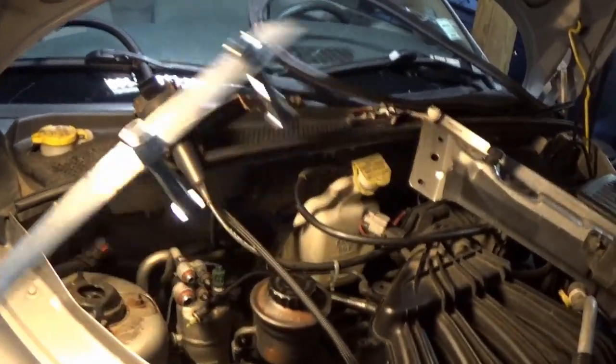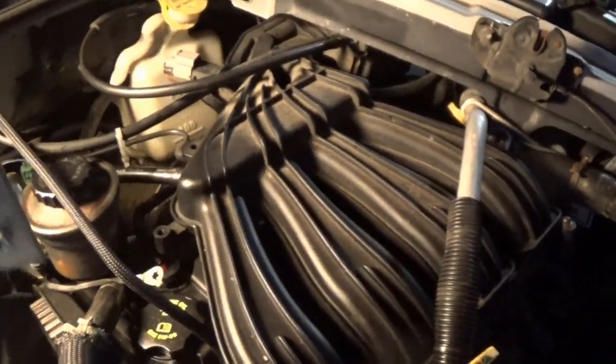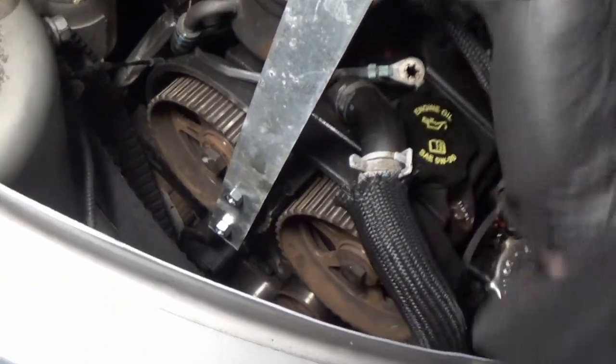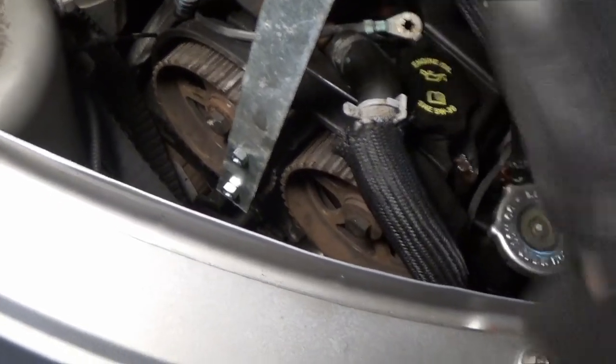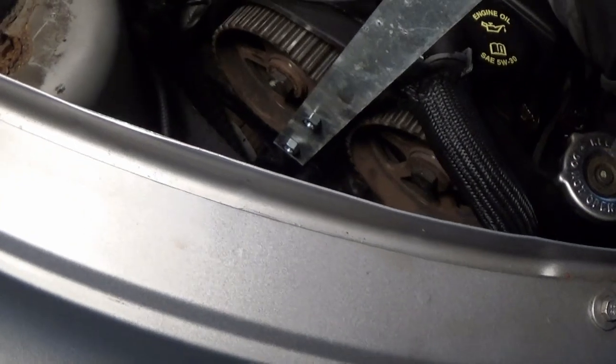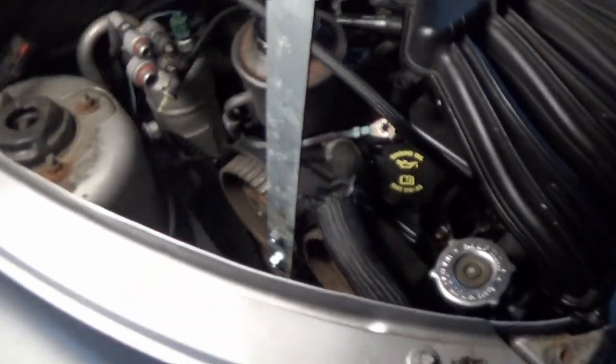I'm pretty sure these are like 5/16 bolts I had laying around. I just used 2 nuts to hold them. I drilled the hole slightly to the side, as you can see, it's fitting between. I drilled our holes about 2.5 inches apart and it worked out perfectly. Fit in our spokes just about perfect when I pull it to the side, and it gives us plenty of room to get a wrench on. Will it be enough that we can put some torque on a wrench and break this loose? I don't know, but we're gonna find out.